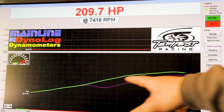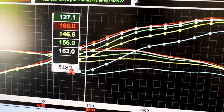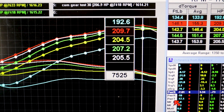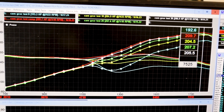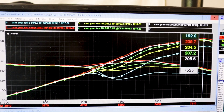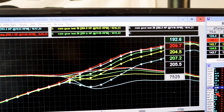You can see how smooth and happy everything looks in comparison. The difference between zero degrees and our composite map — at 5400 RPM it looks like we're at 30-something horsepower difference, so that's pretty significant. And then up here at higher RPM we've still got 15 to 17 horsepower. To do it correctly, it does increase the time you'll spend tuning by 5 to 10 times longer. At least with the K-Pro software, each different cam angle has its own fuel table and ignition table, so there's a lot of going back and forth — but you can see from this that it's well worth it.